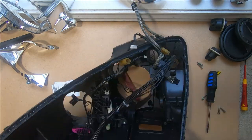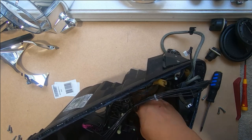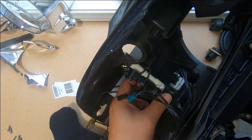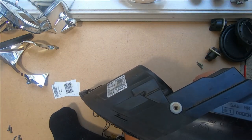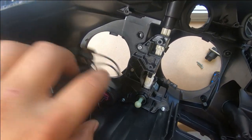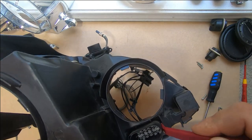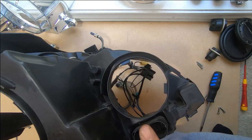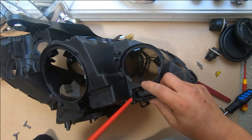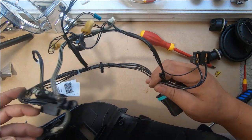Now follow the rest of your cable and make sure nothing is still attached. There is another zip tie holder — just pull it straight out. There is a plug just behind here; pull down on it a bit and then pull it straight back out to unplug it. All we have left is our headlight plug — the pink one. To remove this there are two tabs, one on each side. Get a solid trim removal tool or flathead screwdriver, push them in towards the center and it will release. It slides right out — that is your entire plug harness released.